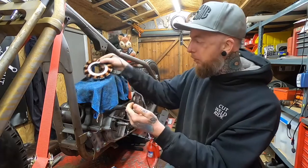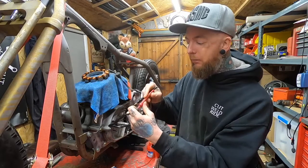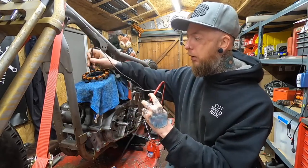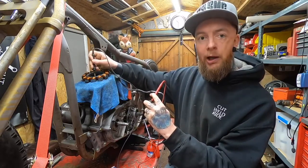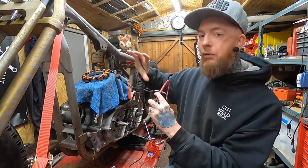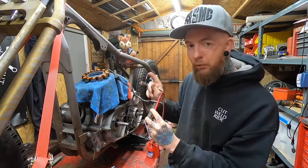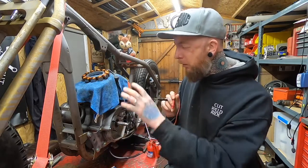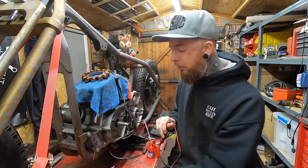Seems pretty cool. That one seems to be working. Take the pin out, drop it into the other one. Oh, where are we? There. And then go round that earth ring again, or that mounting ring again. We're not getting any tone, so that tells me that this stator is okay to a certain degree. Unfortunately, until we actually bolt it in, get the rotor over and get it generating, we can't do our final test on it. But at this moment I'm confident to bolt that into the engine and I'm pretty sure it's going to be working from there.